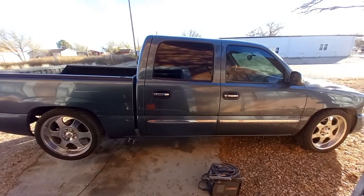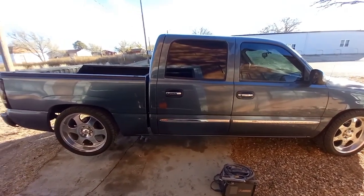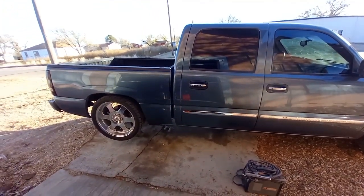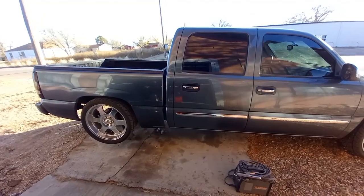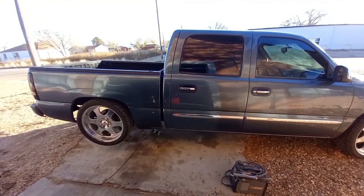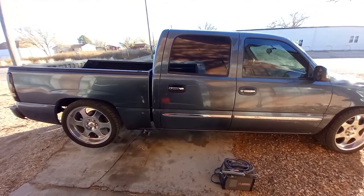We've already done the exhaust on this. We put long tube headers, 2.5 inch true duals, X pipe, with a Cherry Bomb Vortex muffler. I never really cared for it. It sounds real clapped out. I hate the way it sounds. It gets real clappy. I'm going to put a couple of clips in of how this thing sounds.